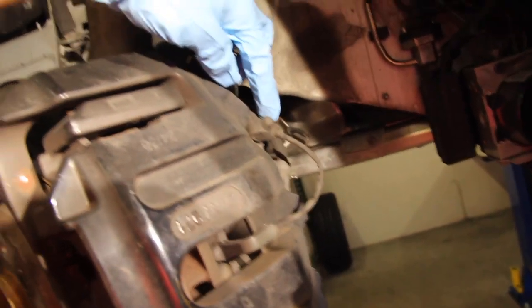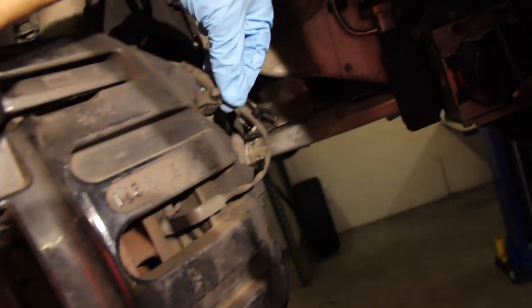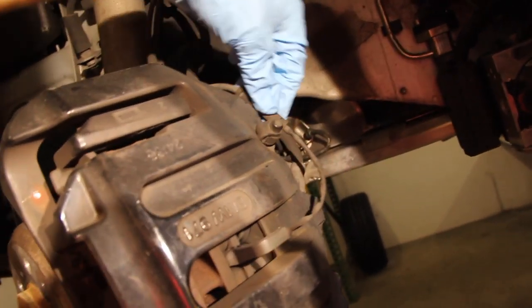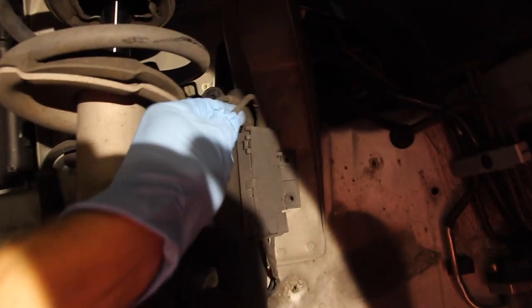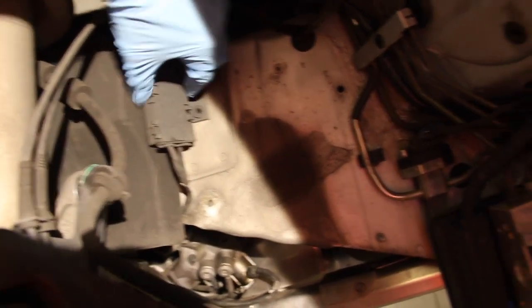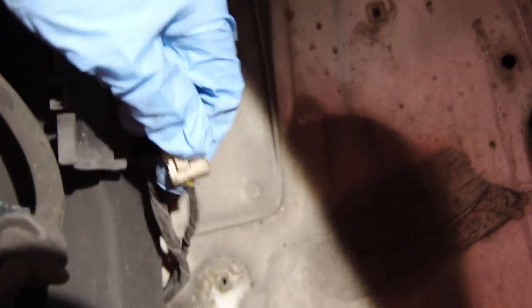So right now, if we follow the wire, the first stop is this little nub right here. Usually your fingers work, but this one's tight, so we'll have to get a screwdriver in there, pry up - the nub comes off - and then that will allow us to slide the little circular connector off of the bleeder screw. Then we follow it into this bracket; it pushes into the bracket from the side - I'll need some pliers to pull that out. Then continue to follow it and it goes into this electrical box which has some hinges on it. It'll hinge open one way or the other and we'll be able to disconnect the sensor inside. Then it's got a big old school connector with a tab on the bottom - press the tab in and it disconnects. And then wiggle the sensor out of the pad.